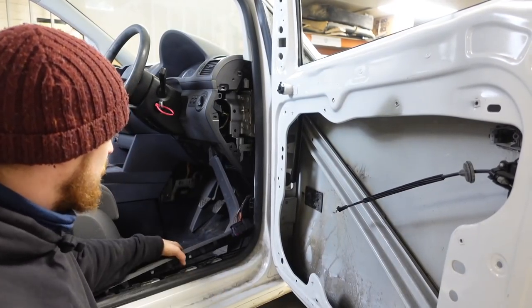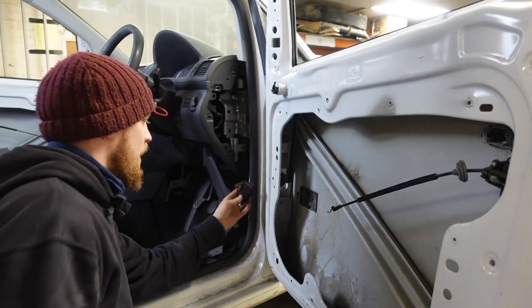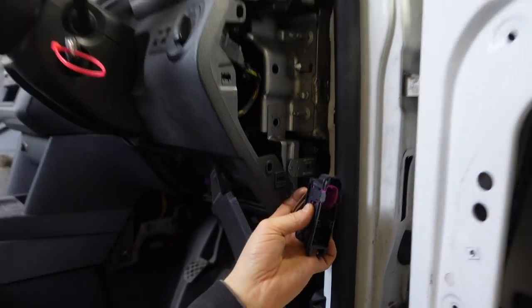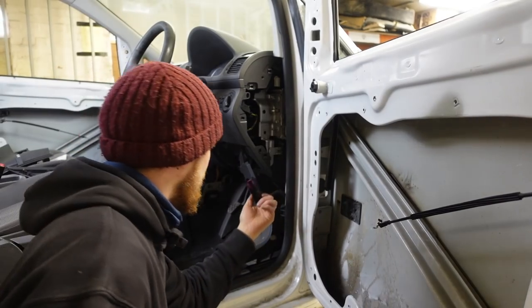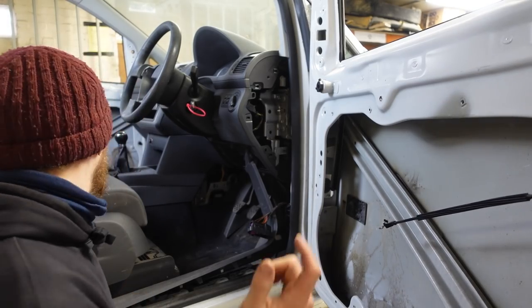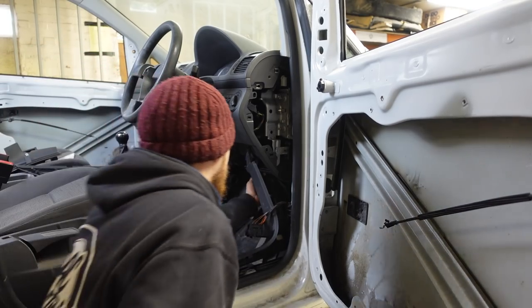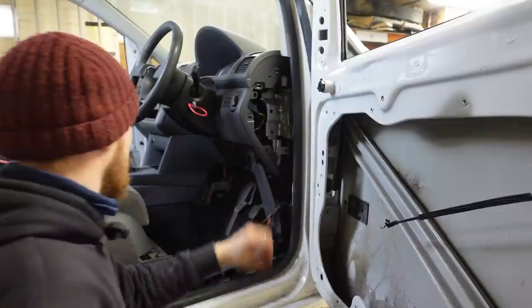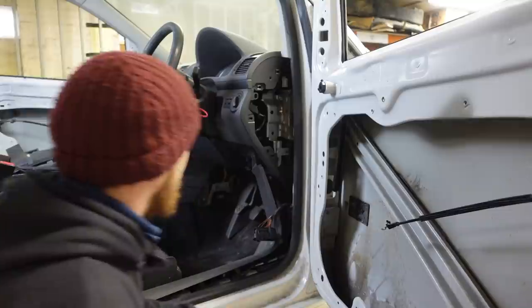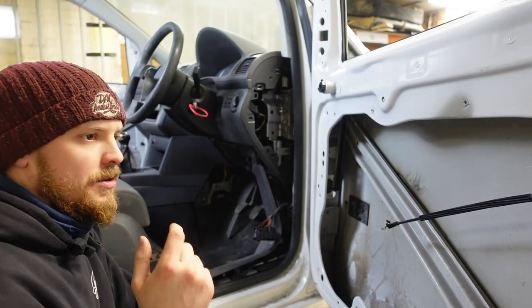It's not the perfect way of doing this - I've just pulled this trim out of the way a bit. We've got this plug out now. To get the connector out of the A-pillar, all it is is these two clips here - pull them in together and it comes out nice and easy. That makes it easy to work out where that pin wants to go. I'm going to run around the other side, pull that apart to get it exposed, and then we'll have a look at the fuse board as well.